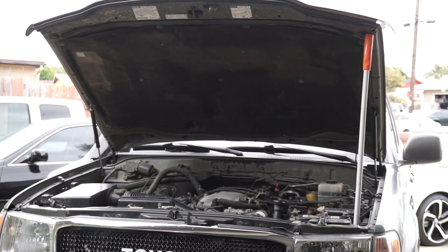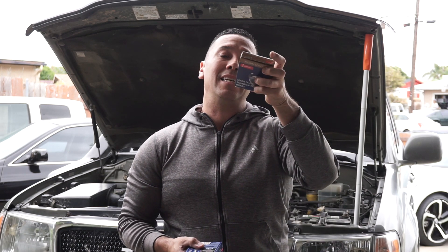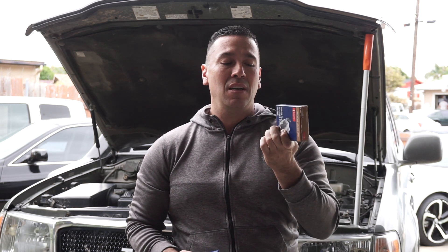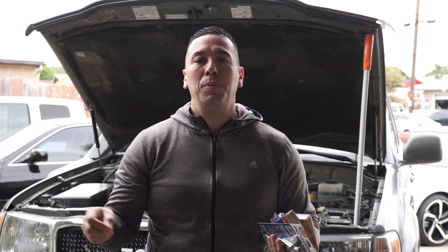I also picked up at my local parts store — and you can get all this stuff via the links in my description below — some Denso SK20R11s. I did link the OEM Toyota part but it was going to be about 14 bucks a plug. I could have got them cheaper online, but I went down the street to my local parts store and picked up pretty much the same replacement. We're also going to be using some ultra black gasket maker with maximum oil resistance for the valve cover edges. Some of the videos and forums I've seen recommend putting a little bit of gasket sealer on there. So we're going to go ahead and knock this out. Hopefully you guys enjoy this.